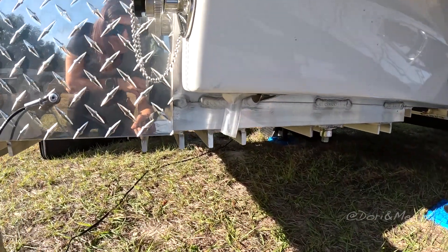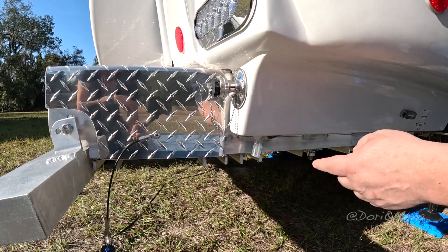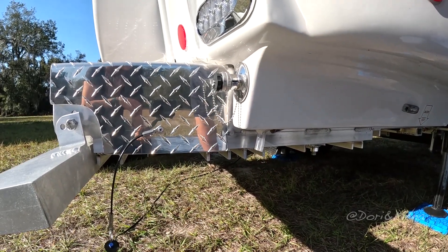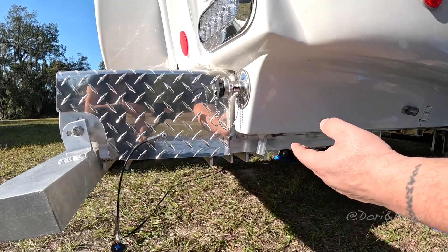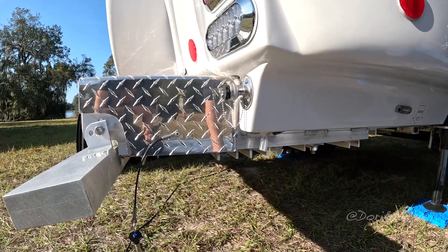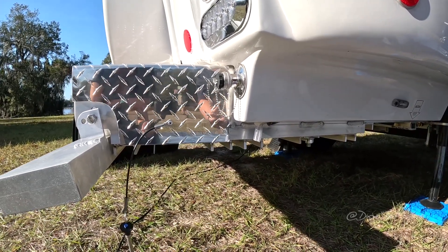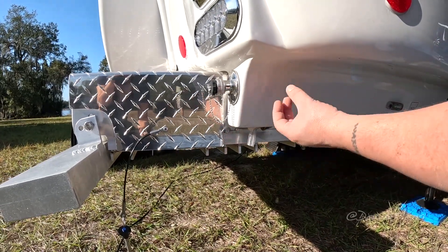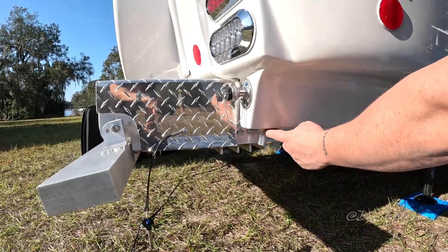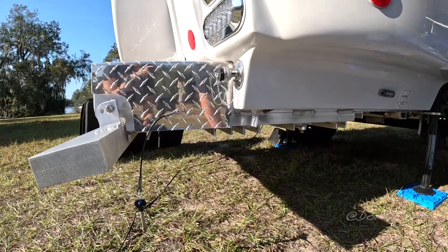There are two tubes that come off of your air conditioner condensation cups. Typically on these trailers the condensation just overflows and comes down the side of the trailer — we didn't want that because it ends up staining the trailer. So we put a tube between the holes — double-hull construction — that comes from the AC and the condensation drips down below the trailer instead of coming off the side.